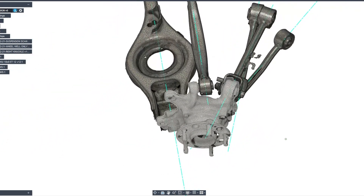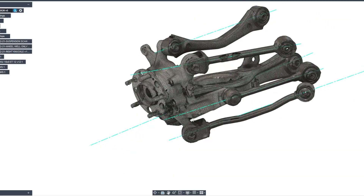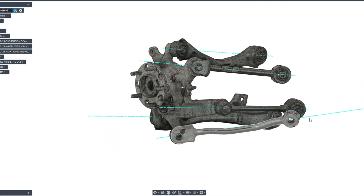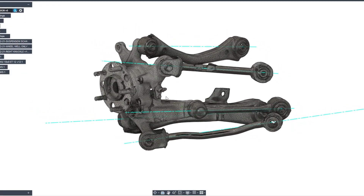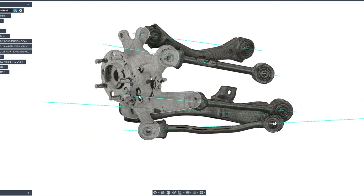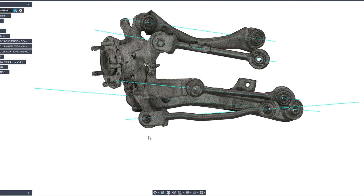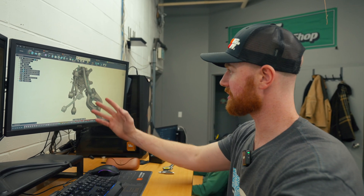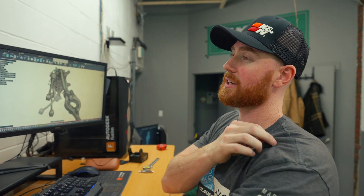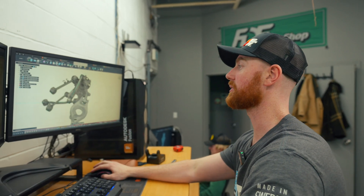If we hide the wheel and start cycling the suspension, you can see what these lines are doing — it's absolutely wild. This one would be considered pretty interesting: our trailing arm and traction arm and how they are positioned. If you lower your car, it can absolutely destroy any amount of anti-squat, which is going to affect your grip. These five links actually have pretty good toe control — once under compression they do toe out a little, but it's not nearly as bad as some other suspension systems.